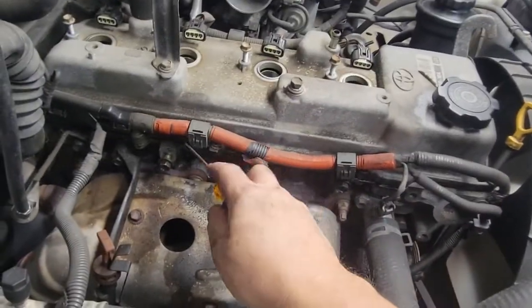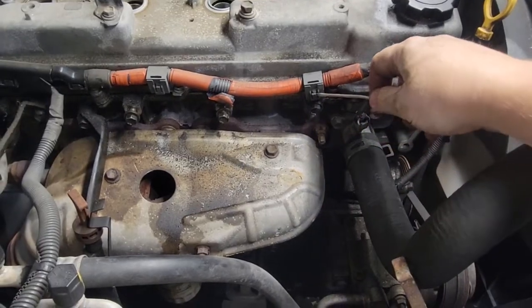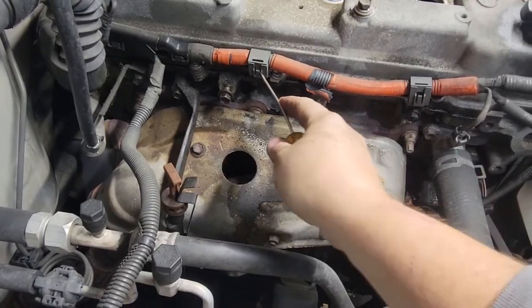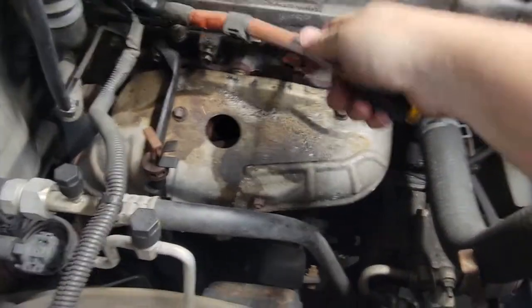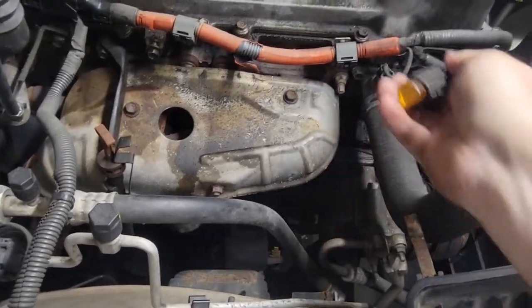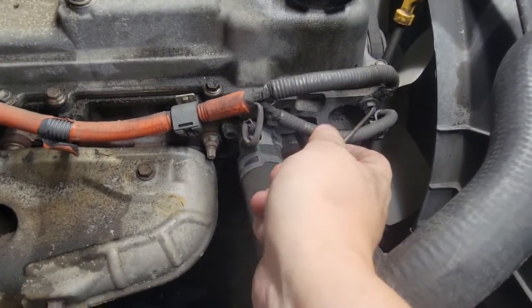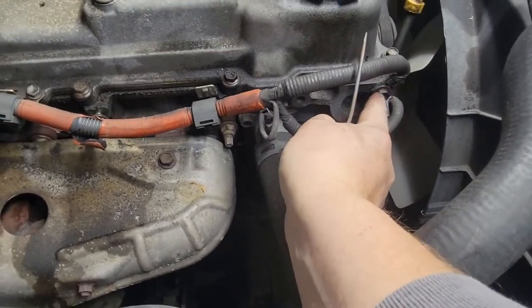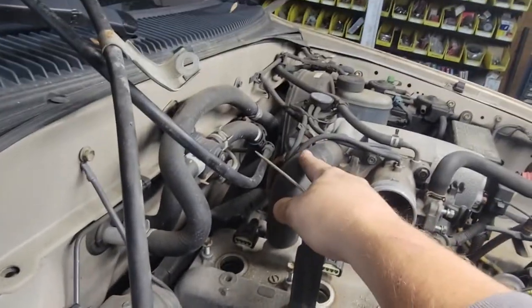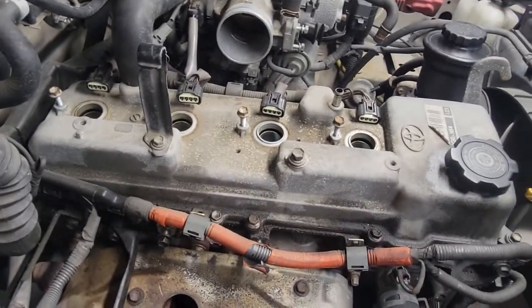To get these off your head, all you're going to do is pull back that little clip right here and pull straight up — it just releases it, quick and easy. We have a ground here, looks like another 12 millimeter over here, so we can take off that ground. From here we've got to take off the hose and we might be able to pull off the valve cover.